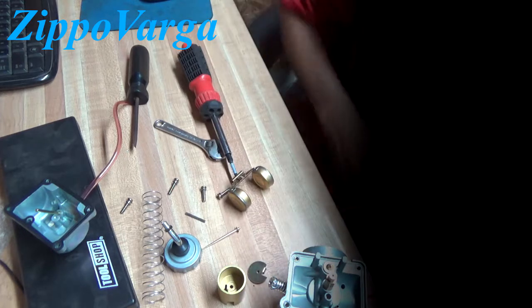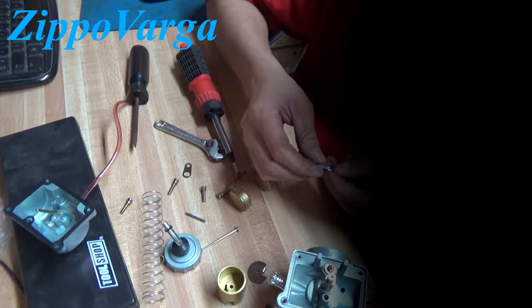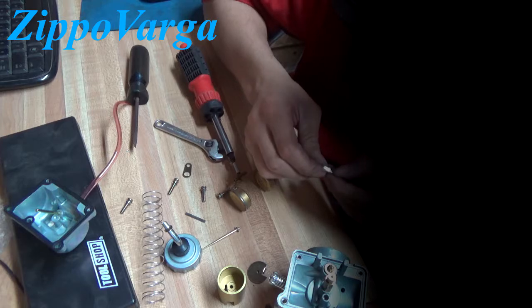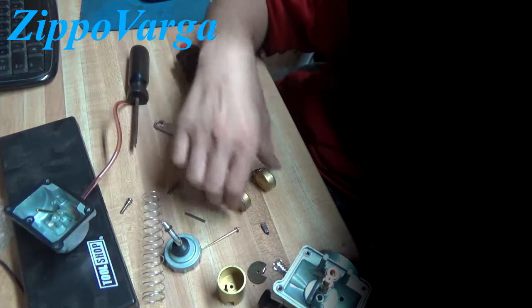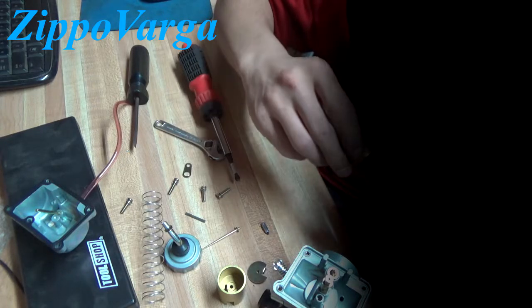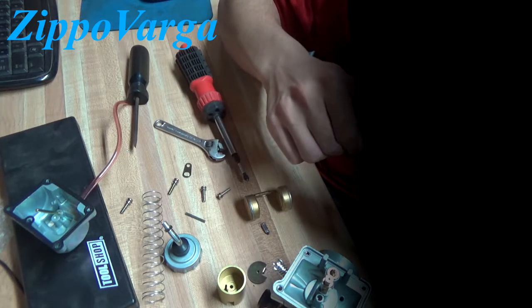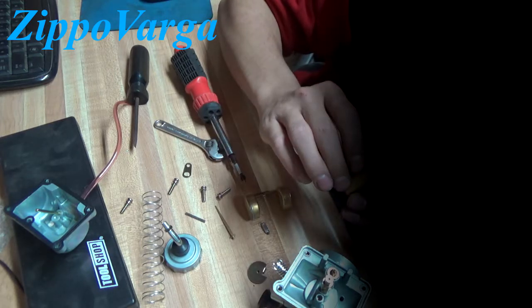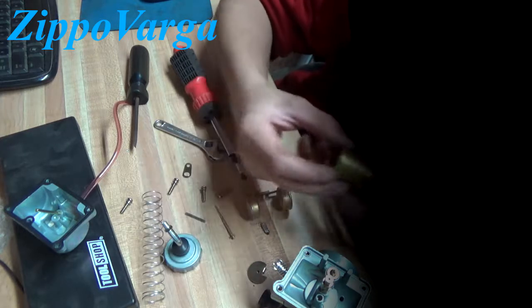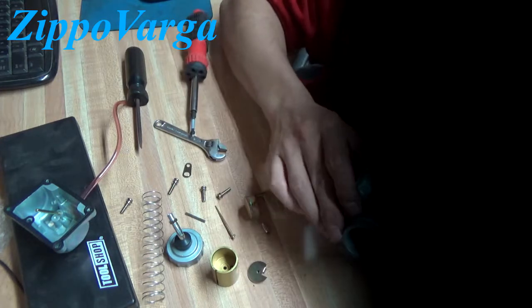Looks like it uses a Briggs float on it, or a seat. Yeah, that's a Briggs seat. So a Briggs seat could work. Needle, I mean. Nice aluminum float. Looks like she's set on her third notch. Looks like brass or pot metal. Probably pot metal. So yeah, not a bad little carburetor from what I can see.